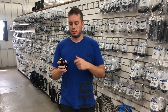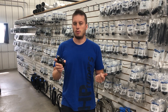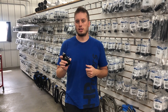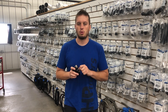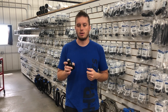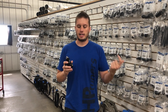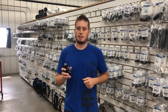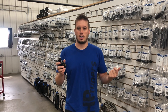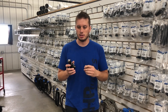In turn, they're needing a boost reference port on regulators. If you're not familiar with that, what a boost reference port does is it adds pressure on top of spring pressure so that it can increase your fuel pressure one to one as your boost levels go one to one. So for instance, if you add 10 pounds of boost to an engine, it's going to take the intake manifold pressure, put it on top of your fuel pressure regulator and add 10 pounds of fuel pressure to overcome that pressure inside of the engine against the fuel itself.